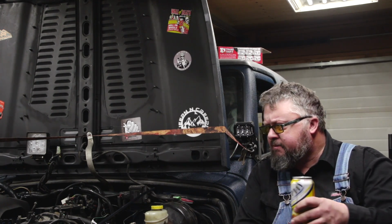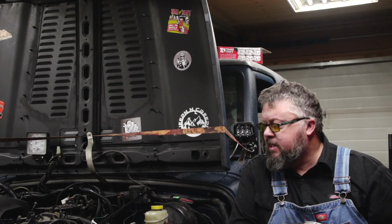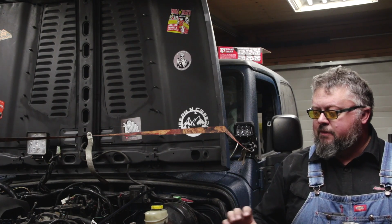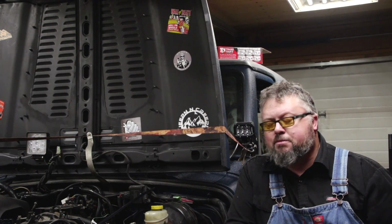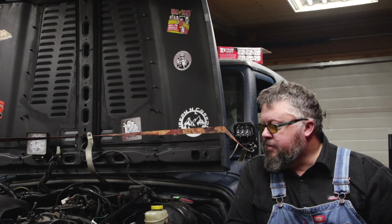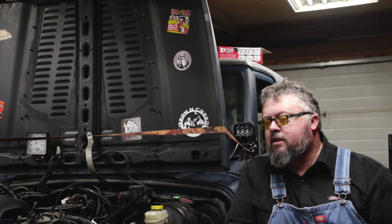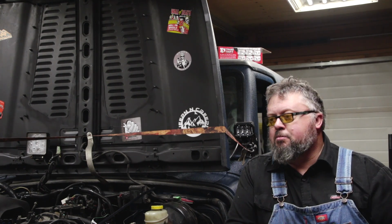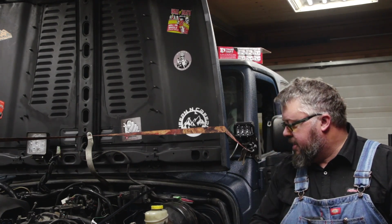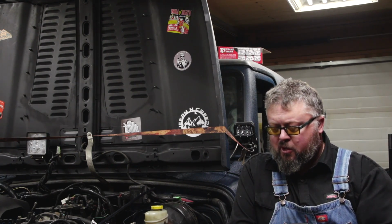But anyways, this video took a lot longer than I had expected. Fabricating up all those little parts. The oil filter relocation beat me to death. Finally found the best possible location. I probably spent about 3 hours test fitting, trying to figure out every angle, mocking up the front drive shaft, thinking about accessibility. How easy is it going to be to change? On the bottom would have worked out really good, but then I'm exposed to rocks. I would have to build a cage, and I think right up here is probably the best spot, and I'm still in range for the hoses.